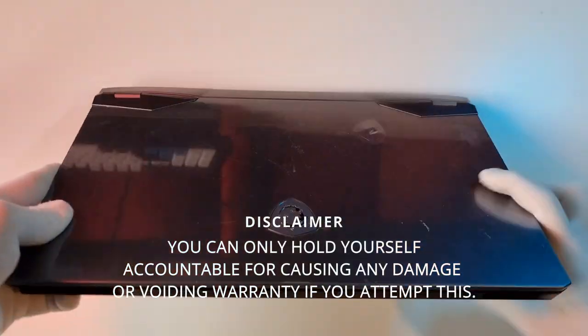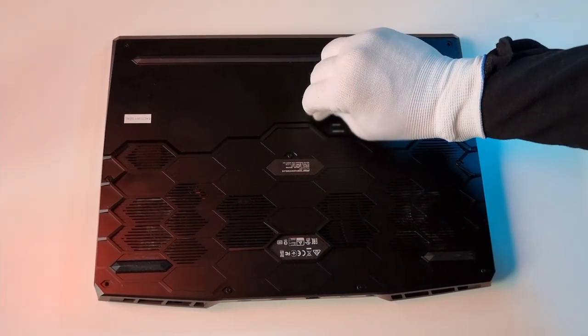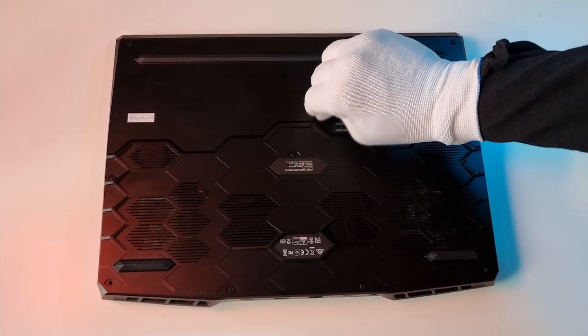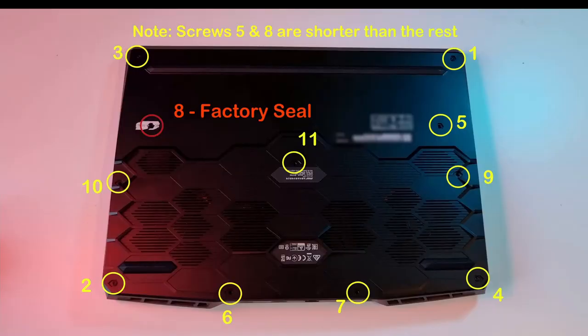How easy is it to upgrade your laptop? Let's get started. First step: a pin through this hole to cut off the battery supply to the motherboard. Then you have to follow this sequence to remove the fixings from the lower cover. Shout out to mflab for sharing this information — you can find many similar guides scattered across the internet.